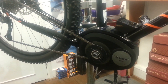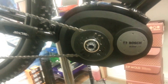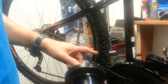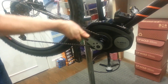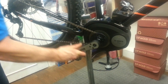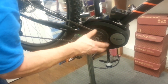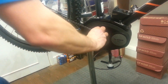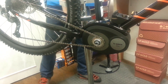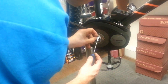You can see there that we've got a lock ring — some of them are like this, some of them are silver. I'm going to put the lock ring tool onto the half inch socket wrench. You can either use a chain whip at this stage; I'm actually going to just hold on to the back wheel as I wind this clockwise, as it's a left hand screw. That's probably going to wind off now quite easily by hand. Then we've got a little o-ring here — I'm going to just grab a screwdriver to remove that. Nip that underneath and tweak it off.